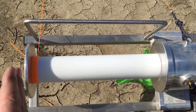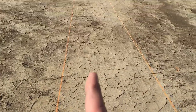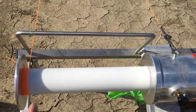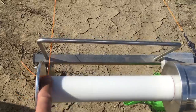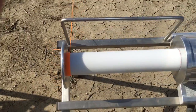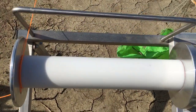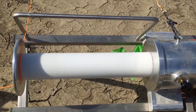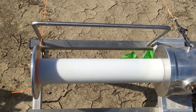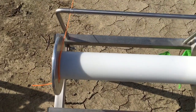So you cut off all excess line. Don't cut it too short or you'll have tension on the winch — tension from the turnaround back to the winch. Cut at the right amount so that when you walk the chute back it pretty much stops just right there. Now that you have the line the correct length, you're going to tension the winch up and make sure it starts wrapping perfectly cleanly.